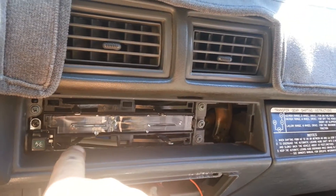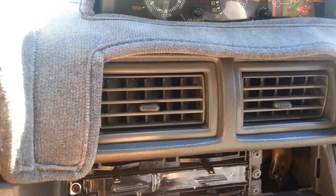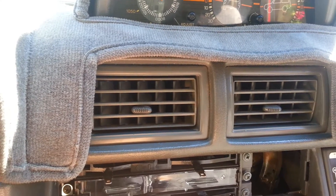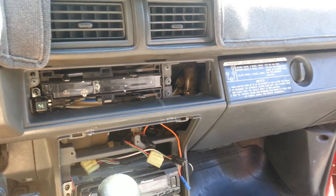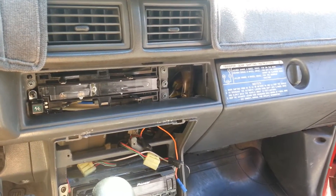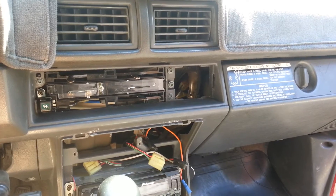Now with the key on you can see: one, two, three, four. Four is definitely higher than the three-speed top speed, and the low is definitely lower than the lowest speed on the three-speed switch. I recommend switching that over if you can find one in the yard - you'll see it's a bigger model. I can actually get you the part number here.